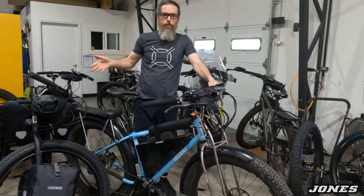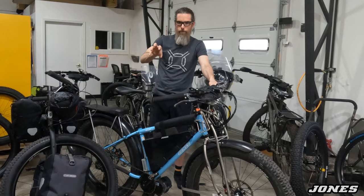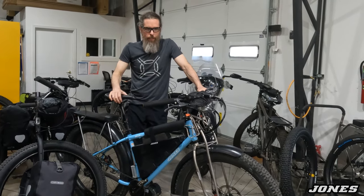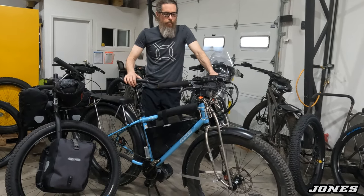It's extremely hard to have a regular LWB bike endo, but a regular bicycle is pretty top-heavy because you have a light bike down here and then a rider up here, so your center of gravity is about here. But when I'm on a setup like this, my center of gravity is dropping a lot and I can just grab a fistful of both brakes as hard as I can — the bike doesn't endo. It's kind of like a car that way, it's so stable.